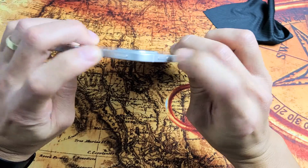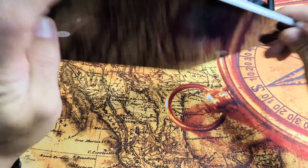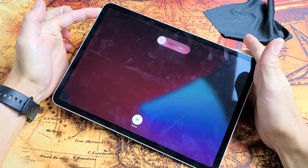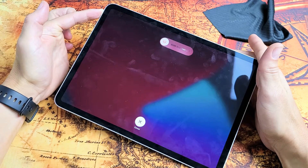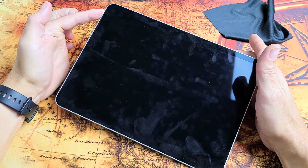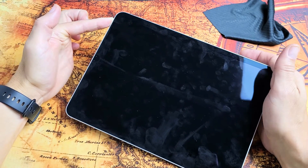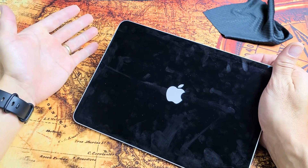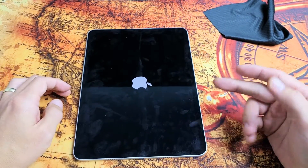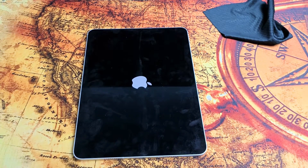If it's not on, do the same thing to restart it. Volume up, volume down, and then press and hold the power button, and do not let go — just waiting for the Apple logo to appear. There it is — go ahead and let go of the power button and let it boot up normally. Hopefully now you are out of the black screen. If not, we're going to do the next possible fix.